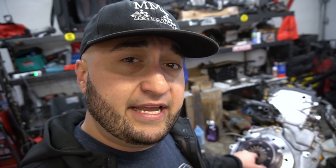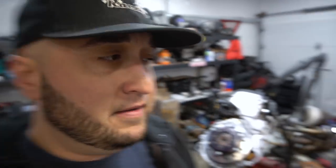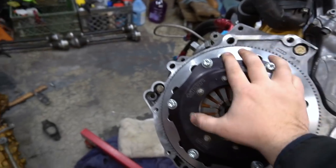For those of you who have had issues with the Tilton clutches, I now have the carbons in the car. They're way over mileage so I'll have to shim or replace them — that's just what happens with carbons. The cerametallic discs — the only issues we had were the center splines, but they held up pretty well. We'll see how much power Stav ends up making and whether they slip. For the splines, if you've had issues or you're looking to install, make sure you're getting the hardened material on the center.